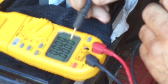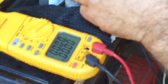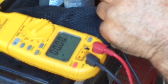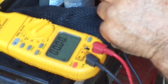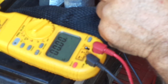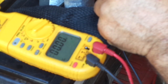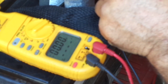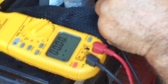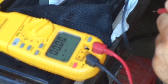Look at our microfarad reading right there. This is a 4 microfarad capacitor, and once the battery charges it up — the battery in the meter is actually feeding the capacitor electrodes inside the capacitor — and if you see it just keeps going dot, dot, dot, it's an open capacitor. It's unable to charge, which means there's no limit to the current going through the run winding and the motor's going to fail eventually. So this capacitor is definitely defective.